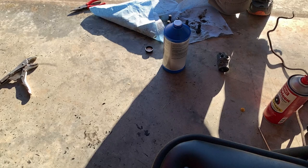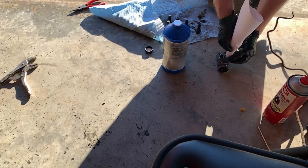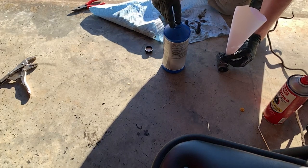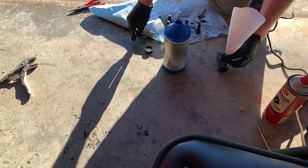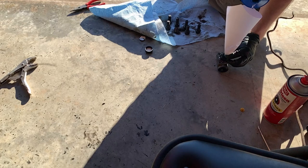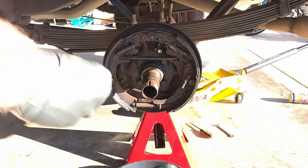A quick and easy step to reduce the air in the lines you'll have to deal with after installation is to use a paper funnel or other small funnel and actually pour just a little bit of brake fluid into the new wheel brake cylinder prior to installation. It won't take much at all to fill it, so don't pour too much, but just by pouring this little bit in it will go back through the brake lines when you reinstall.